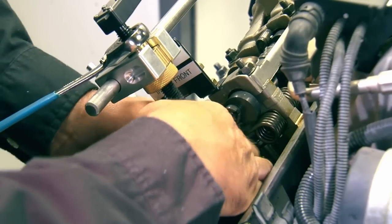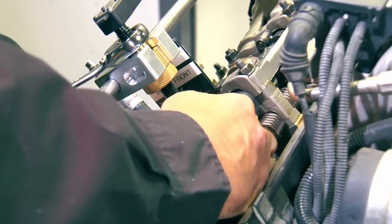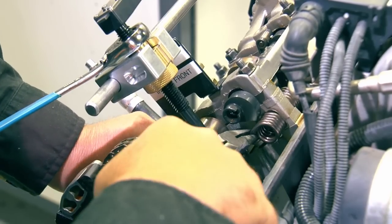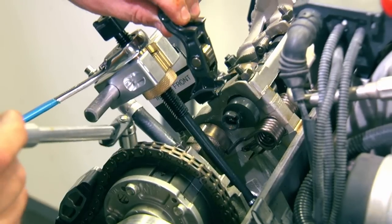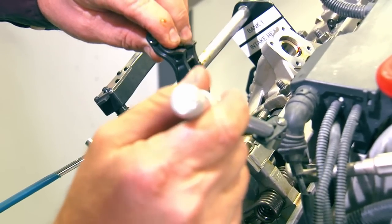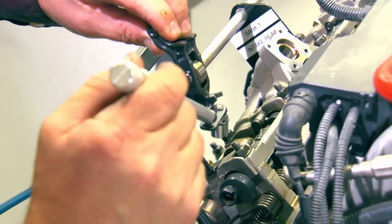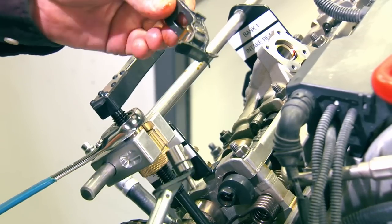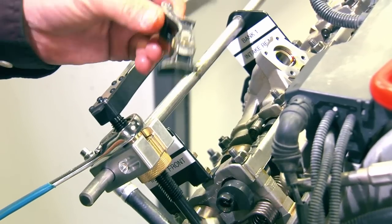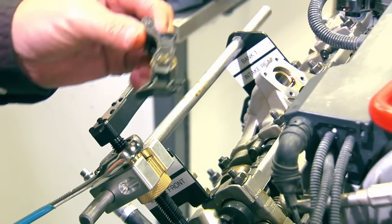Just one more time shown out of the car. The lever sits like this in the car. You come in with the tool, just slide it in between, dip down to install the keepers, come back up and pull out. You don't have to take this lever out — if you want to you can, as it gives you a ton of room to work with, but it's really not necessary and it just makes the job longer.